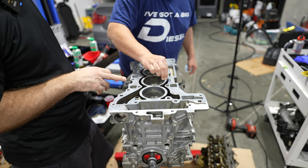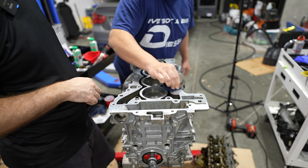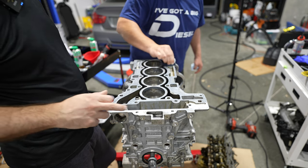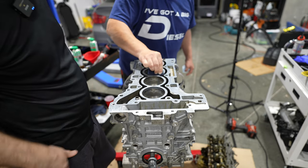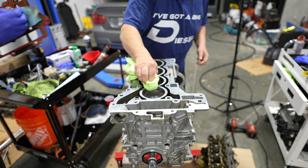All right, so you're hitting the surface with some Scotch-Brite. Blue Scotch-Brite. Is it very mild? Yeah, these are the Skillcraft from Harbor Freight, actually, because they're cheap, but they're non-scarring. So we're basically knocking away any corrosion and leveling the surface after we put the cleaner in preparation for laying the head gasket in place.